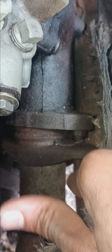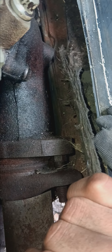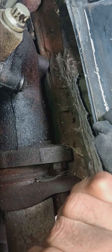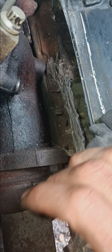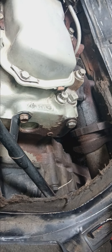You'll be able to turn this out this way to remove this bolt. Will this be able to slide out without removing the entire exhaust system? There is a great chance that can happen. This is a 9/16. I don't have enough strength to bust this without a breaker bar, so I get me a 24-inch breaker bar. They're not rusted bolts — they're nice and oily, which makes for easy removing.